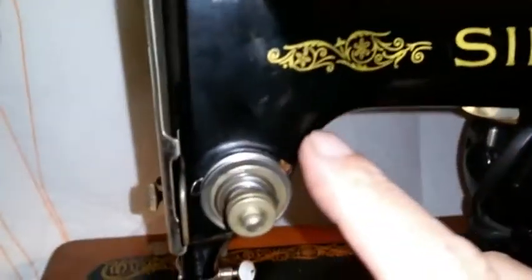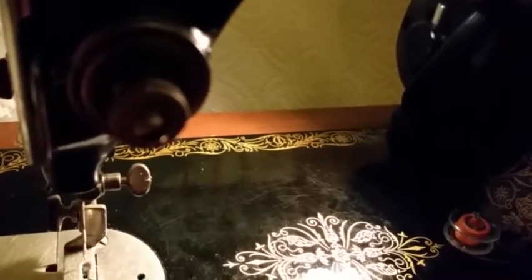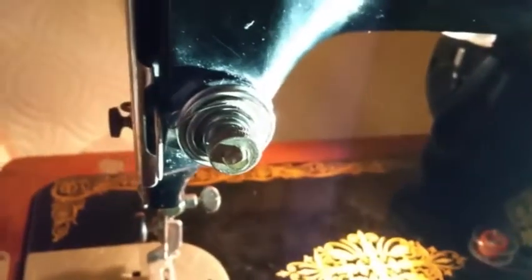That's all it was. And then, of course, coming over here, another odd thing. This is the tensioner. This is where the thread will go through and be basically pinched with a certain amount of tension, and this will help to create the stitches. Up here is your take-up arm, which will move up and down. Some ornate decorations on the front here. Make it nice and pretty.